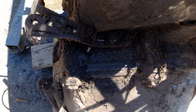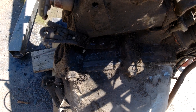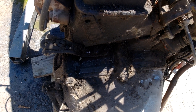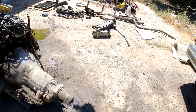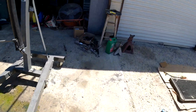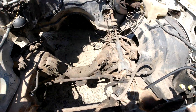Here's the correct engine number: 460778. It comes out to a 1978 or '79 305, two-bolt main, comes in a car or a truck. There you go — original engine. I scraped that off — I'm going to scrape off all this grease in here and I'll be back.